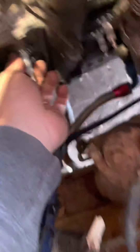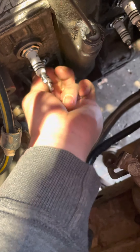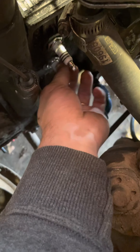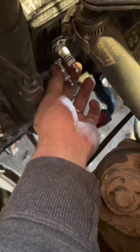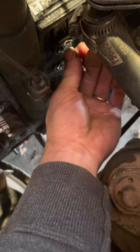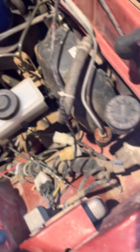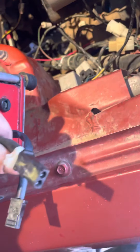Four new spark plugs. As you can see, that one I kind of got tightened in but this lower one — that one's kind of in. I just hand-unthreaded that — not supposed to be that way — but you can see it's real flush right there. There's not much to grab to turn it; you actually have to turn the porcelain, and that breaks spark plugs stupid easy.